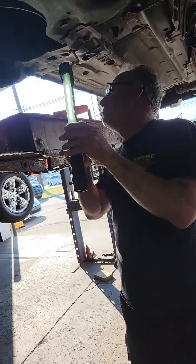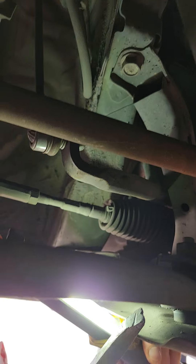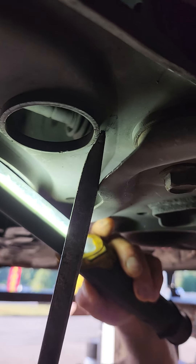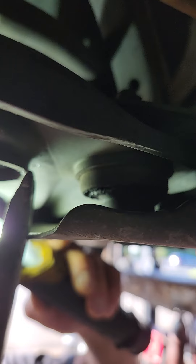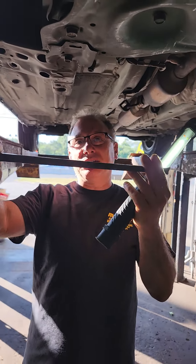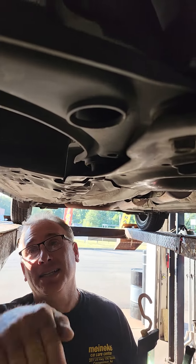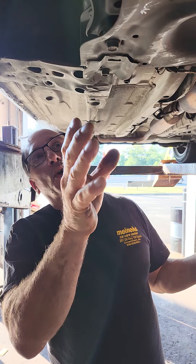So then I was like, well, I know something's moving, so take a closer look on this side. I've seen a little bit of rubber debris there, so I'm going to take my pry bar — and you can see that right there. See, the bushing is separating. See how it's moving up and down. So when I'm hitting the brakes under load it's doing this, but it's not showing up in a normal inspection. If the wheels were hanging it probably wouldn't show up because it's not that worn out yet.